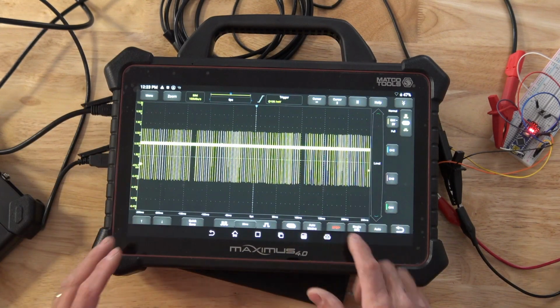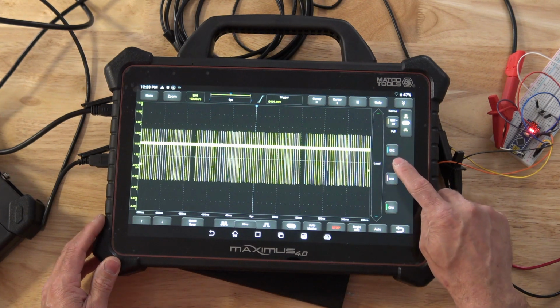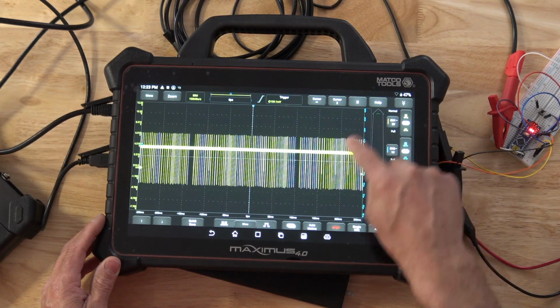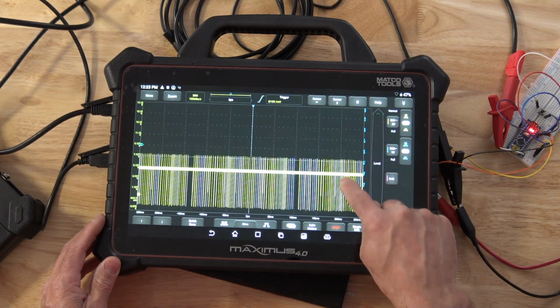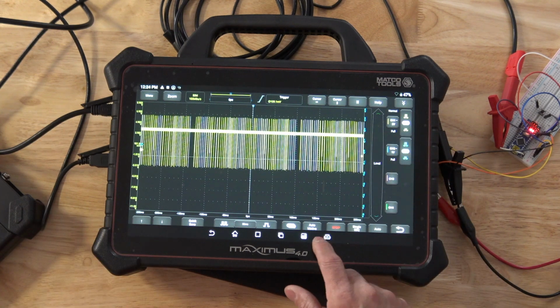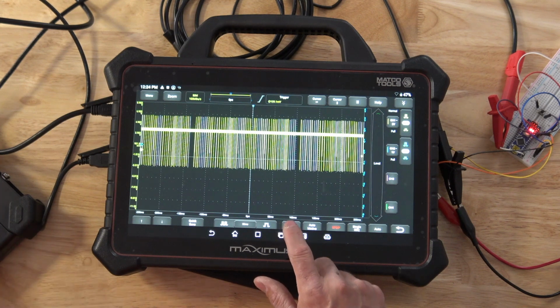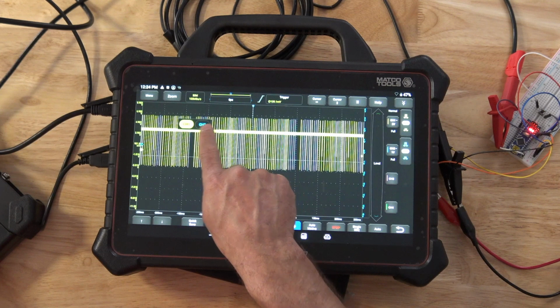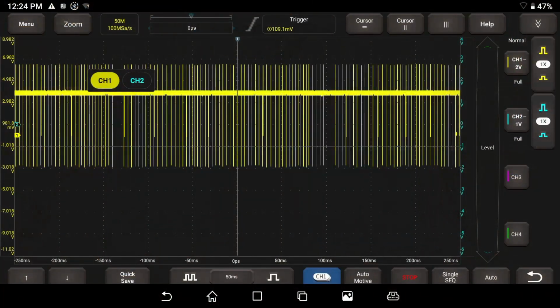Something else important here is if we turn another channel on, I'm going to turn channel 2 on by clicking on channel 2. I can actually move channel 1. You see, I'm just moving the screen up and down, but I have channel 2 on. To select different channels, you actually have to click on this button right down here, right next to our time base, or our time per division. You click on this button. Now I can select which channel I want to use from right here. I select channel 1 or 2. So I'm going to select channel 2. And then now when I move the screen, I'm actually moving my channel 2.